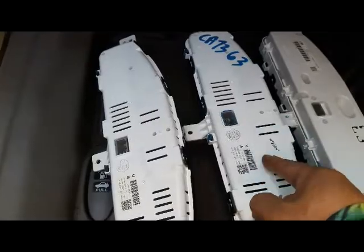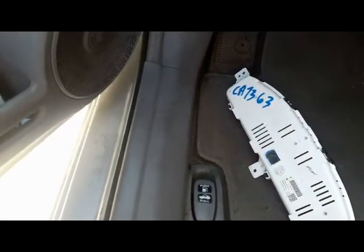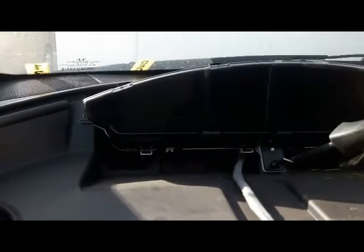What I'm going to do is put this replacement in and test it. Like I did with the OEM, I'm going to spray the contact cleaner in there, give it a few minutes to let it dry before connecting it and putting them back in. After a few minutes, connect it in like so — make sure it's snapped in. Then mount this on. It's got a guide pin on both sides, so make sure the guide pins are in and aligned on the bottom so you can align the screws straight.